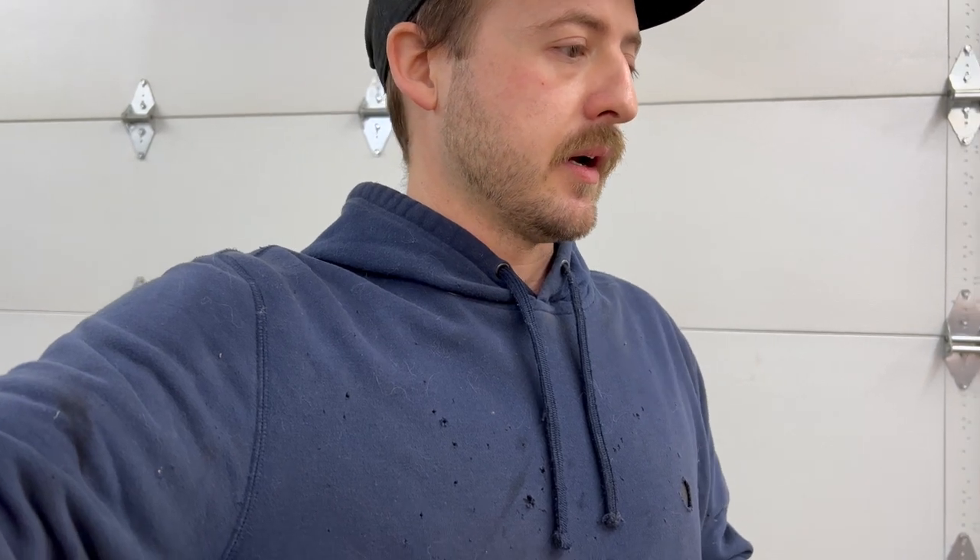New day and we're out here finishing up the Mazda. Got my finishing swirl remover compound, which I've never used this kind before. Normally I'm the type of guy that does restoration work — I do full paint jobs, and after I clear coat I always cut and buff. I've never really been a detail guy as far as grabbing a car and just giving it a buff. I've done it a couple times and I always get bad swirl marks with my wool pad. Maybe I shouldn't be starting with the wool when you're not doing any form of cutting. I could be wrong, but it's not bad.